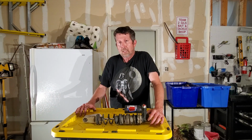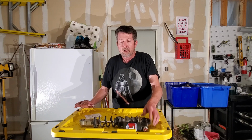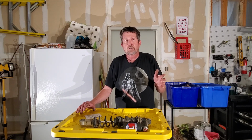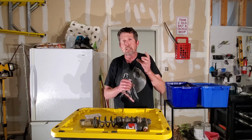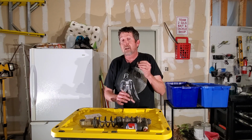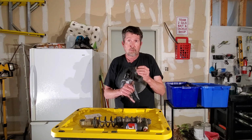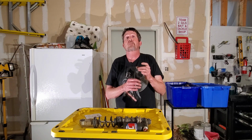The more difficult one is if it's too tight. So I'll give you an example of what it is. I can't really tell on this tight there, so I'll explain how to adjust it here in a minute. But if it's too tight, let's say you got 8 inches of shock travel. You go over a series of bumps. The first bump you hit compresses your shock 3 inches, so now you only got 5 inches left. Well, if it's really slow, the shock will start to expand again, and let's say it only goes out 1 inch, then it hits that second bump. Second bump compresses 3 inches. So you went in 3, so that's a total of 5. You went back out 1, so now you're back at 4. Now you just compress 3 again.